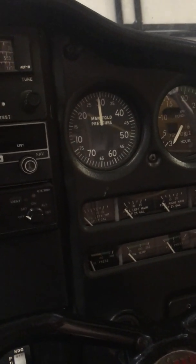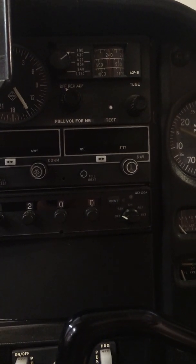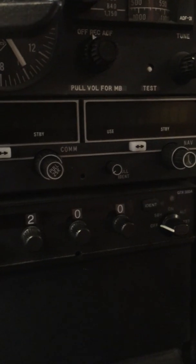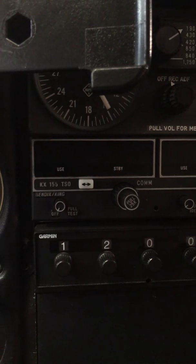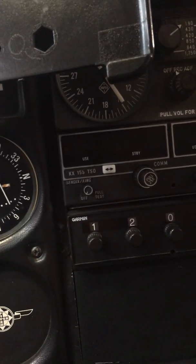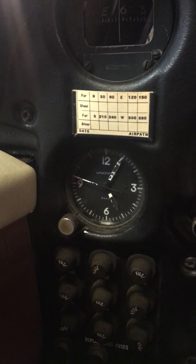Some of the things we're going to need extra for instrument flight are also covered under that same chapter, 91.205. In addition to all the VFR day and VFR night instruments, we're going to need what's called the GRAB acronym. G stands for generator or alternator — this airplane has an alternator. R stands for radios and navigation equipment — this plane is equipped with a single KX 155 with com and nav, which is the only source of communication for this airplane, and technically that would be legal. A stands for altimeter — sensitive and adjustable for barometric pressure — so we have an adjustable altimeter and altitude encoding capability.